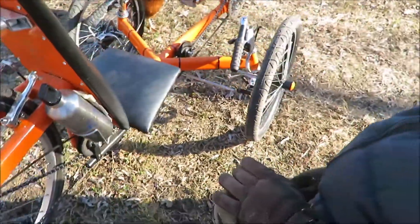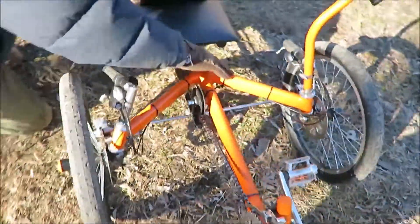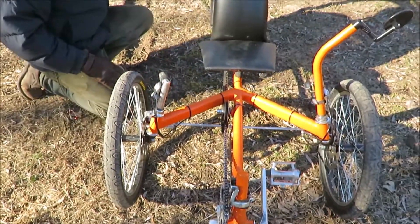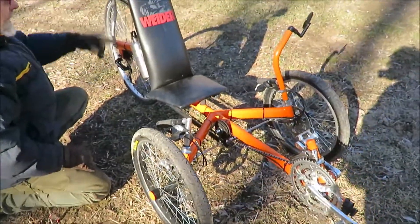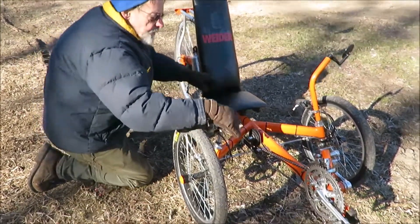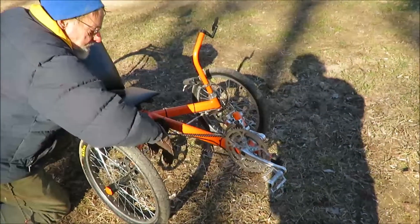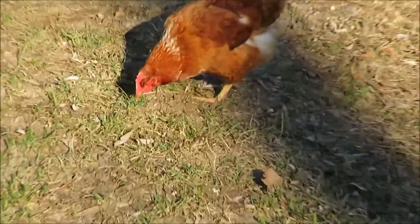The big screw-up on it is that where the front axle wheel booms attach, they're attached too far back. Because of it, there's too little weight on the back end. If I'm going up a hill and there's gravel on it, I spin out — it doesn't have enough traction on the rear wheels. The reason I moved these back was so that this can be used by Shirley if I want — she's got real short legs. It's got adjustable pedals so it barely clears her heels, but because of it there's not enough rear traction.